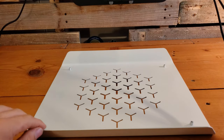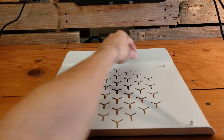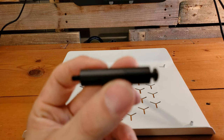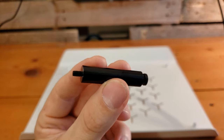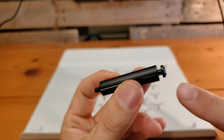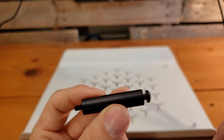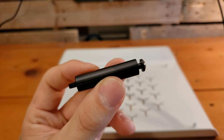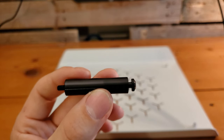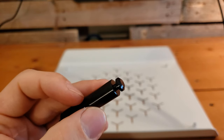At the back of the front panel, we've got inserts in all four corners for the special spacer screws. One end of each spacer screw goes into the front plate itself, and the notched end is the end that goes into one of the slots on the back panel and slides down into place so it's not moving around or falling off. We get these screwed into all four corners, then we're ready to put it up on the wall mount.